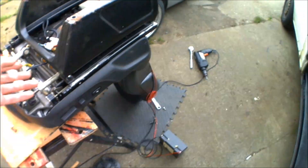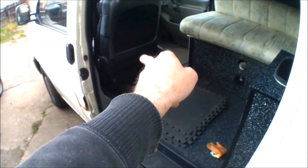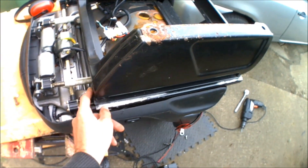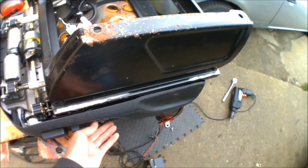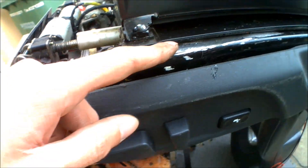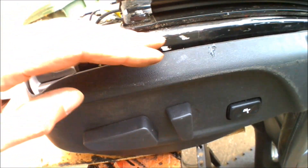Right, so that's the seat mounted to the base — now it's ready to go in and have the securing bolts secured back onto the floor and have the wiring run in. I highly recommend having the electrics hooked up while you're trying to mount the seat to the base — it means you can move it back and forwards to get better access into the different corners. For safety I've actually used the original mounting holes on the base for an entire side — straight through the runner — and I've still put a steel plate in there as well just so it's level on both sides. There's a little cut-out in the metal plate for the brass screw just to keep the height the same.